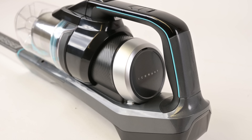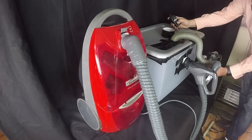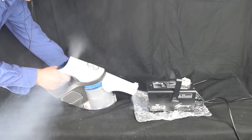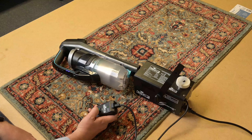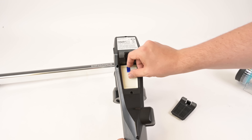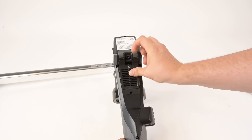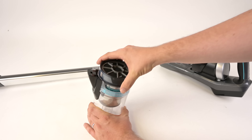The next pro was filtration. I've become something of a filtration snob since starting this channel, and I've seen how important it is to buy a vacuum with a sealed system and a good filter — otherwise you're pretty much just putting what you vacuum up back into the air. Most cheaper cordless vacuums are not sealed. So I was happy to see that the Bissell Icon Pet passed our fog test with no visible fog, so it wasn't necessary to do the more in-depth dry particle test. Even though the post-motor filter isn't technically a HEPA filter, it's very close to HEPA, and more importantly it's a true sealed system — a great choice if filtration is important to you.